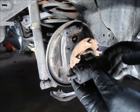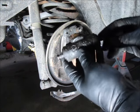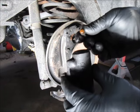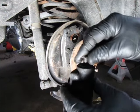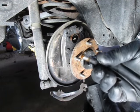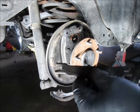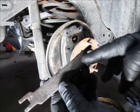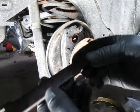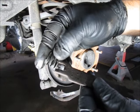Here's just one other thing I want to point out. I pulled the wheel cylinder off and noticed that all around it in the back it was wet, and when I pulled the little plungers that ride on the pistons inside, they were wet too. That tells me this wheel cylinder has been bad for a while — it was basically just leaking fluid and not doing its job. I'm going to salvage those plungers for the new wheel cylinder. Also, the shoe adjuster — the spring goes around this end, and in this case it sits so that the spring goes towards the front. It won't even fit the other way, so make sure you have that orientation right.